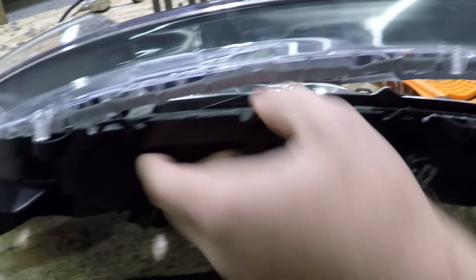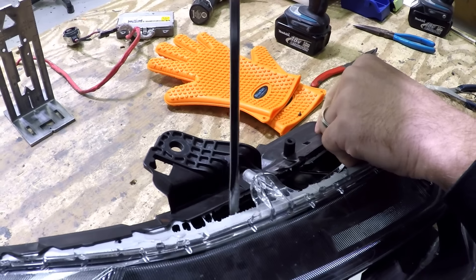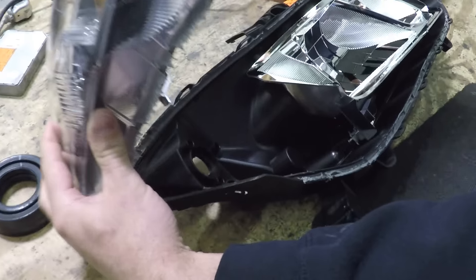I'm going to remove this light and discuss how to open it up cleanly and safely. Most of you guys are going to be using a flat head screwdriver. We always start on the bottom of the headlight because we don't want to see any pry marks along the top edge. If you're going to pry it or chew it up — which we really don't do — you're going to do it at the bottom. I like to start on the corners because the corner has a lot of strength, going from the bottom to the side. You're going to stick the flat head in and give it a twist. I personally use the spreaders. Once you get in there with the spreading tool, make sure your tabs are all flipped up, because once you're spreading, you can rip them right out — and some lights only have tabs, so you don't want to rip one.